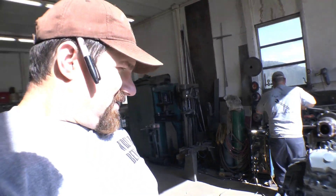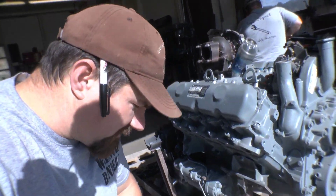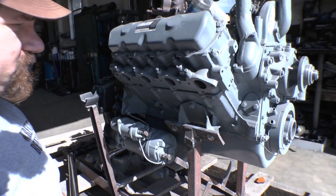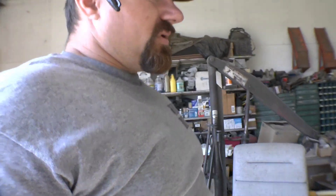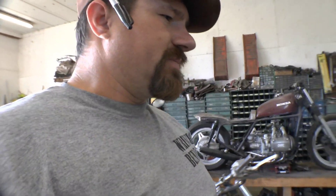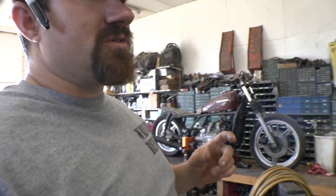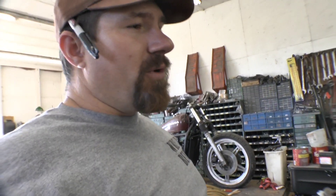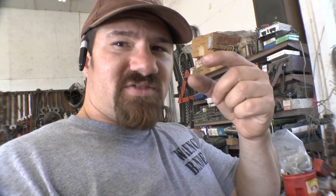As much as I possibly can. So on this engine — you guys saw the log manifolds I made — I'm going to be using studs to stud the flange to the engine. There's a little bit of an issue: if you're looking for exhaust manifold bolts for one of these IDI motors, the factory manifold is a lot thicker where it bolts to the engine, and these flanges are only like a quarter inch plate steel, maybe half inch. My point is you don't need as long a bolt, and I want to use studs so I can get the nuts on the outside, get the studs on there, put the flanges on, and I don't have to worry about bolt length.